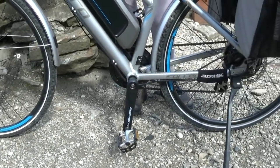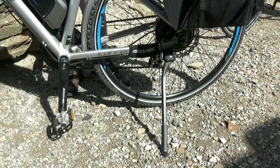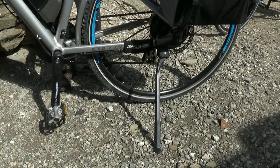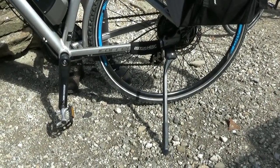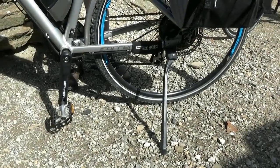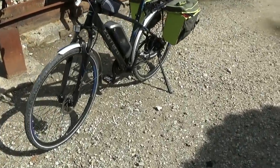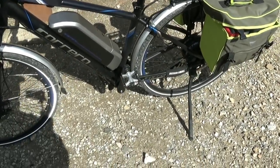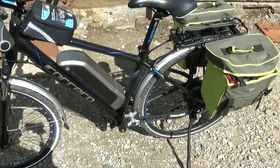But you do have to be very careful to make sure that the bike is parked pointing a little bit uphill, so that the gradient allows you to lean the bike properly onto the stand. Because if you just park up on a level bit of ground and there's a bit of wind, you might find the bike gets blown over, or it starts rolling away or something. But nevertheless, I'm not knocking the fact they're there, because they're blinking handy. Just having that side stand, as long as you know it needs setting up right when you flick it down. So, I think that's it.